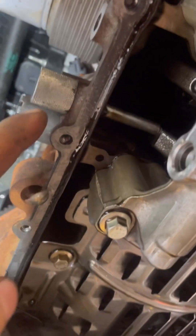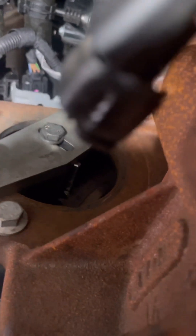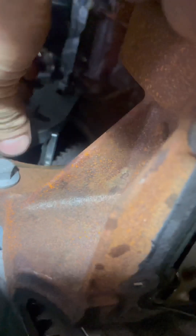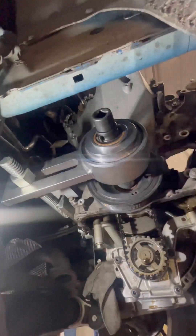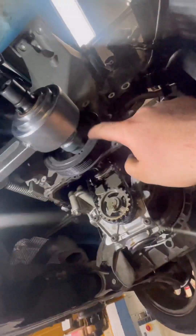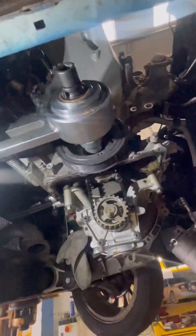Now we've got the cams locked off, with the lower timing pin still in place and locked up against the crankshaft. We can now install the crank locking tool securely to make sure it holds the crank in place. Now we have the torque increaser installed — double check the locking tool, that's nice and locked off, cam alignment tools are on. So we'll crack this nut off and get the pulley off. As soon as the pulley is off we'll drop the vehicle down, put the other cam lockers on and then we can get the front cover off.